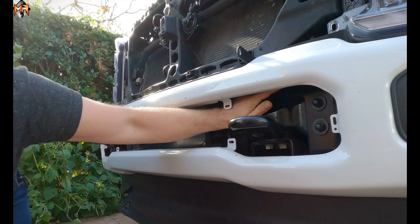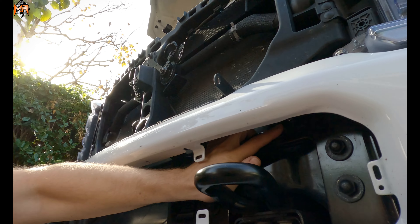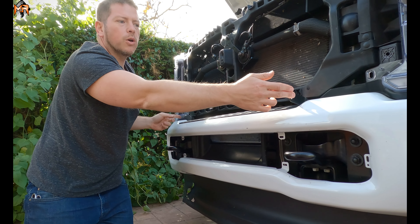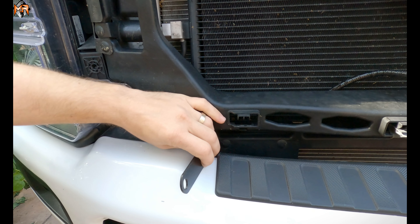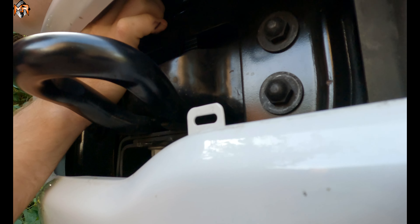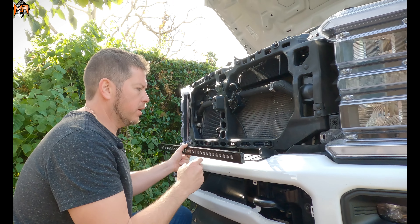I want to show you where that bolt hole is — you can see the shiny hex head right here, that's the one used for the bracket. We only finger-tighten it because I like to have the position of the light bar set first; when the light bar goes in between, then I tighten the sides. I'm going to do the same thing on the passenger side — slide the bracket in. The hardest part is aligning it altogether. You'll feel the hole align so the bracket stays out. Now we can go ahead and mount the light bar.